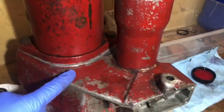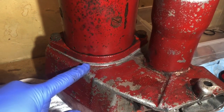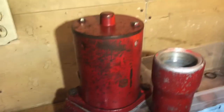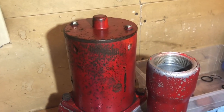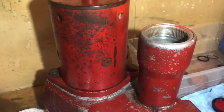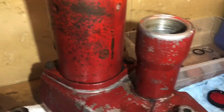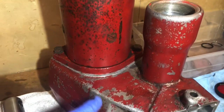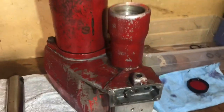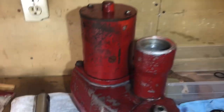We've got this electrical motor torqued. I went to put a thin layer of silicone on each side of the cork gasket — this has a safety layer, not strictly necessary, but my goal with working on stuff is I don't ever want to see it again, meaning until something breaks. I don't want things to come back because something's leaking or moisture is getting through. So next on the list is putting the lift ram assembly in.